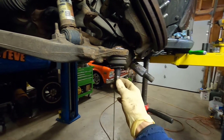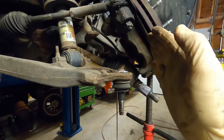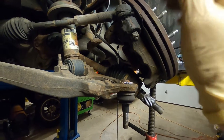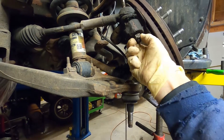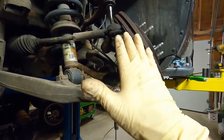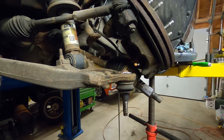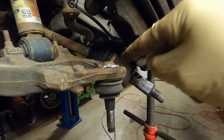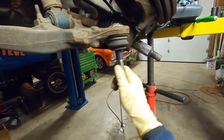The biggest deal is getting this ball joint out. Sometimes you can fight yourself and two seconds worth of work makes it so much easier. I fought the other side without taking this tie rod end off — this side, it's going to be way easier. Just go ahead and remove this tie rod: back the nut off, smack it with a hammer, and it'll pop right out. You don't have to mess with the adjustment — get it out of the way. With the pole jack, we can just push this over completely out of the way, get our ball joint press in here, and press that out. I did take my air chisel and work those crimps over a little bit, so it should come out a lot easier now. But you can see how loose this ball joint is too.